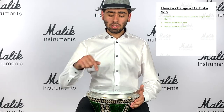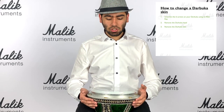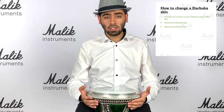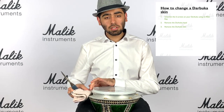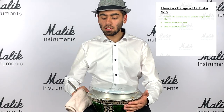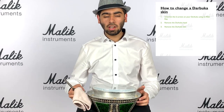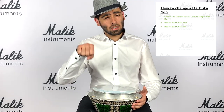Next, we have to remove the plastic head, which is this section right here. When we remove the plastic head, all we normally have to do is pull it from the sides and it will come off. In this case it came off quite easily. If it's not coming off and you're finding it difficult, you need two things: a cloth and a chisel. Simply put the cloth over the metal section, put the chisel down on top of the cloth - the reason you put it on the cloth is to avoid damage to the drum - and you chisel up, turn around, put the cloth down, and chisel up. It should come away as such.